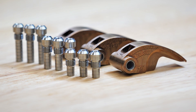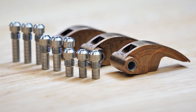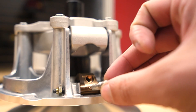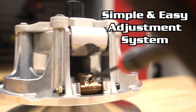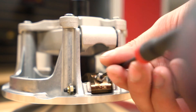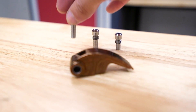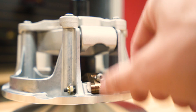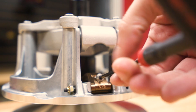There are several capsules available to fine-tune your weight, but your clutch kit will come with three different sizes that fit your application. Boondocker has done all of the legwork for you — these weights come ready to perform out of the package. Start with the middle-sized capsule provided with your clutch kit. The capsule design Boondocker uses is infinitely repeatable since the capsules seat in the same spot each time. The other capsules included are for fine-tuning for different variables like snow conditions, rider weight, track length, and elevation. It is easy to change the capsules without removing the weight from the clutch.